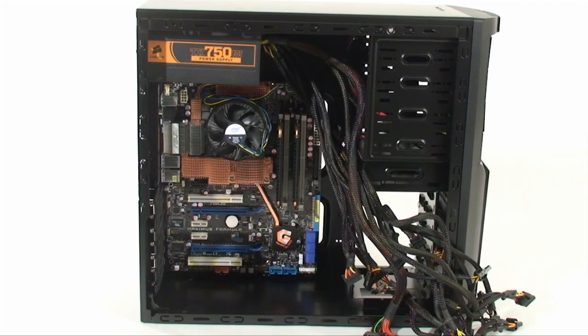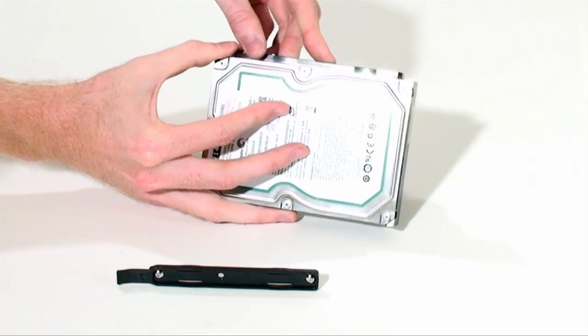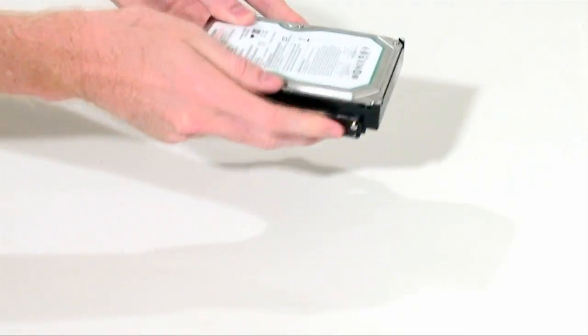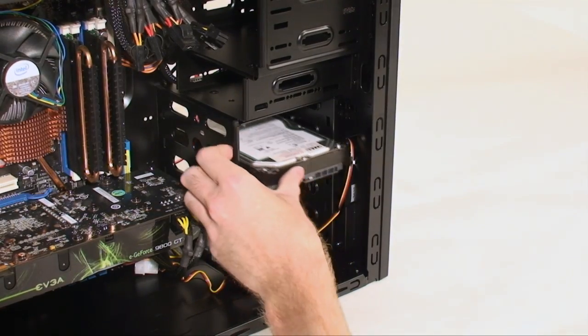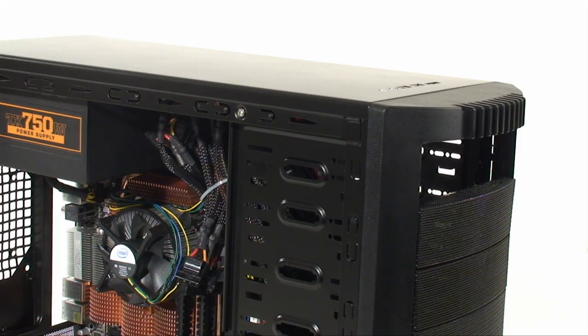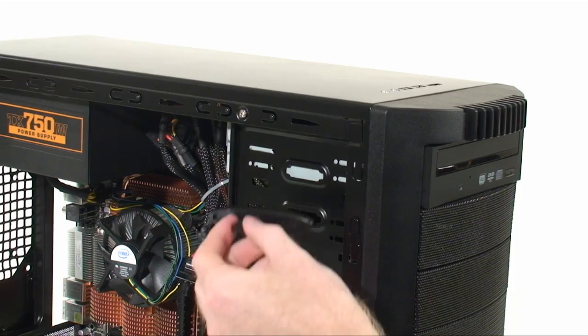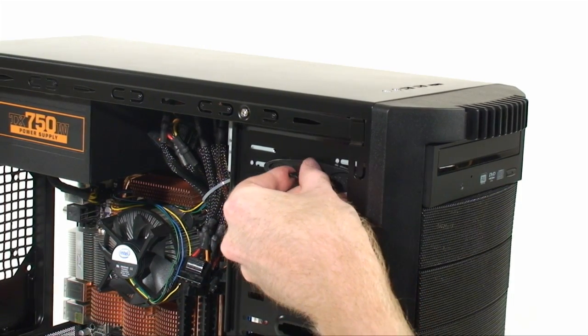Starting off on our installation, we put together the usual components. The drive setup is completely screwless, and hard drives use a simple rail system which slides in and is surprisingly secure. There are 5 3.5-inch bays in the Beta, as well as 4 5.25, and the external drive bays are just as simple. Slide the drive in, twist on the lock.